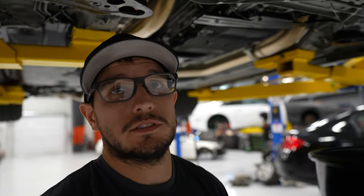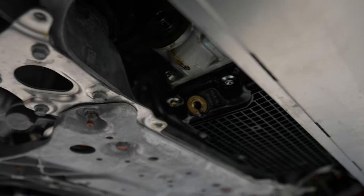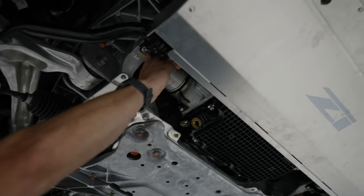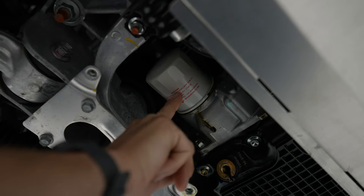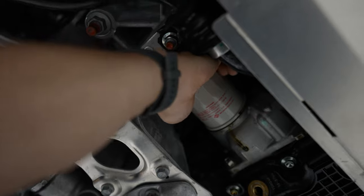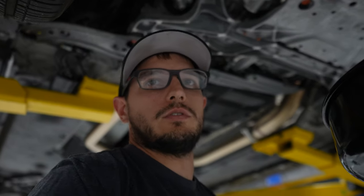It's good and done draining when it reaches the point where it's just a drip — not a steady stream anymore, just a few drips here and there. At this point, go ahead and put the oil filter on — the o-ring's lubed, it's pre-filled. It might get a little spillage, so keep your drain under it. Once the gasket touches the sandwich plate, you just need to give it an initial contact. It actually says right there: screw filter on more than two-thirds after initial contact. It doesn't need to be super tight — you don't want to go too tight or it's going to be really hard to remove next time. Hand tight, no tool needed. Once the gasket touches, give it two-thirds of a turn and you're good to go.